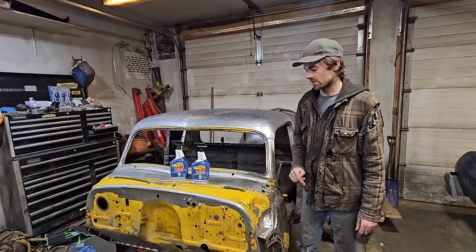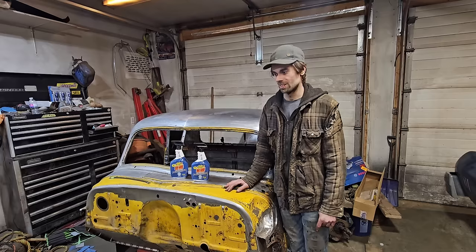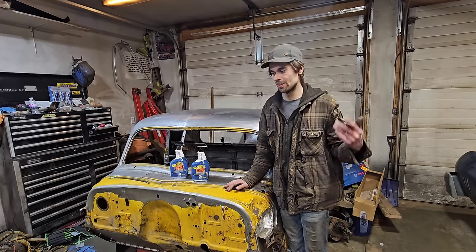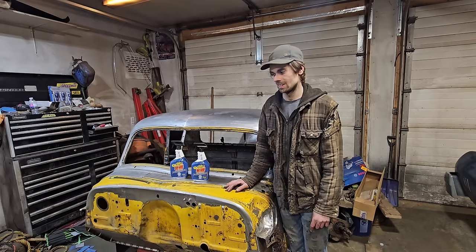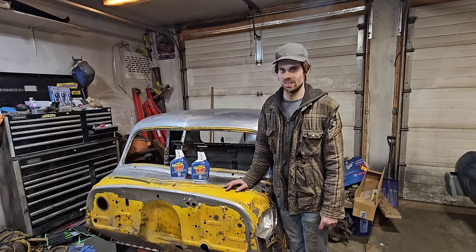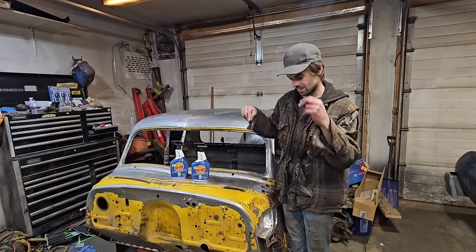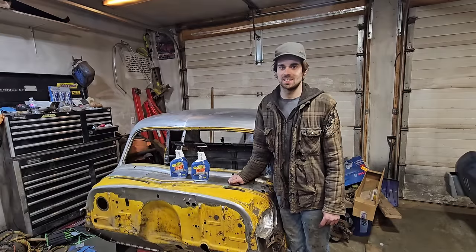So we'll see. Like I said, we should have done a compression test on that, probably before wasting a whole pile of time on it. But my fragile ego just couldn't handle any more bad news right now. I think we've got at least a couple stuck valves and possibly some other issues that are going to come up. So I don't think a basic tune-up is going to help it, even though all the plug wires are basically about to turn to dust.